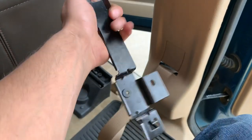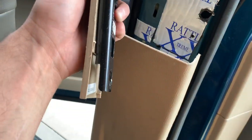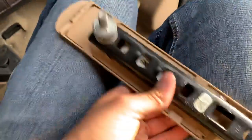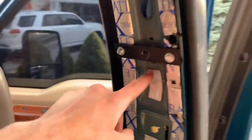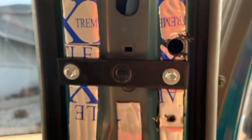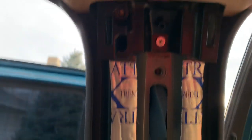This bracket is pretty sweet - let's see how it interferes with my seat belt. So you have a bolt here and a bolt on the bottom one on the floor. I usually put the top one in first, but the distance from here to here on the new truck is not the same as on the old truck. You can see where it is and where it needs to be. So I made a little bracket that just stretches the gap. You could easily make your own, drill and tap it - it doesn't matter. It's just basic geometry and measuring.